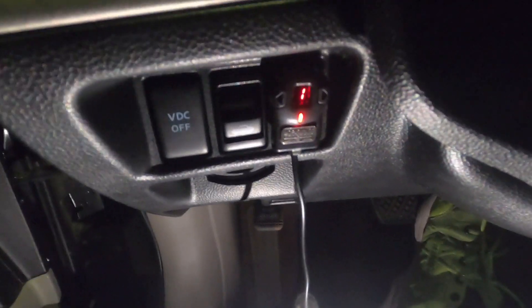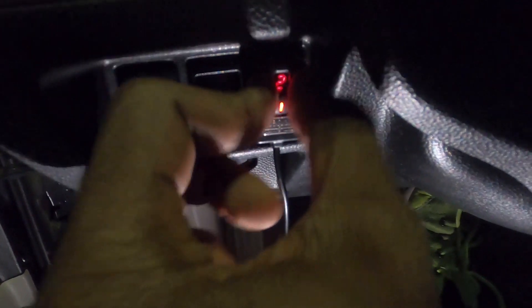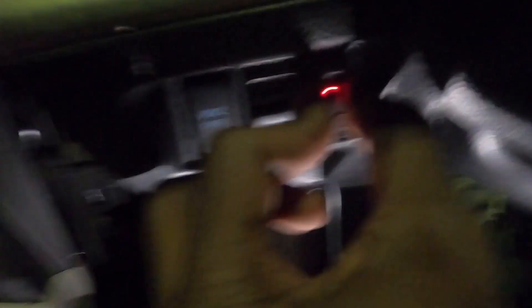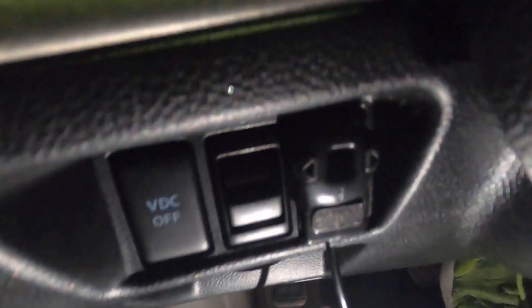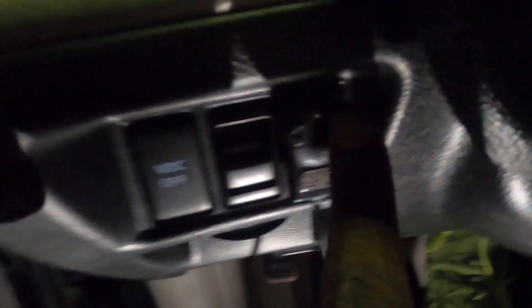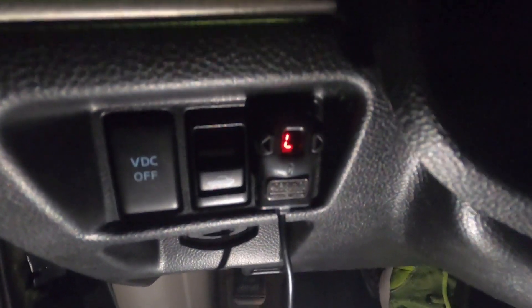I'm going to show you guys exactly how to do that. Leave the car on — you've got two arrows right here, you want to hold down these arrows. Turn off the sprint booster first, make sure the car is not 100% running — just have the ignition on. Go to the left arrow — that's going to be lock the pedal. You want to lock the pedal, hit that, and now you have to type in a three-digit code. My three-digit code is going to be zero-zero-zero. You see the three dots popping up — see that 'L'? It's now locked.